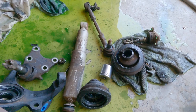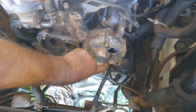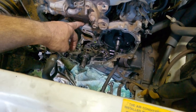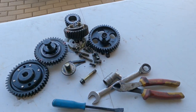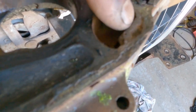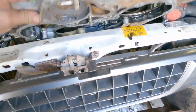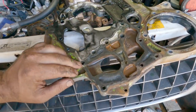Tools and stuff everywhere - we'll rip this off. We've already done the timing - you've got to do your timing for these two holes here with a mirror and a torch, then get this front cover off. Finally got the backing plate out - it was leaking along here because there was no gasket there. You can see exactly where it was leaking. I'll see if we can clean it up and make a new gasket, otherwise I might have to get a new one.